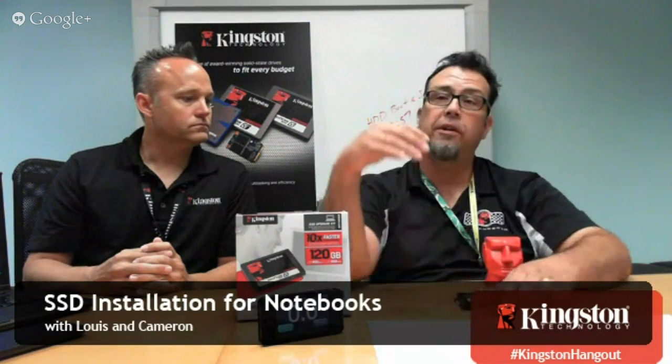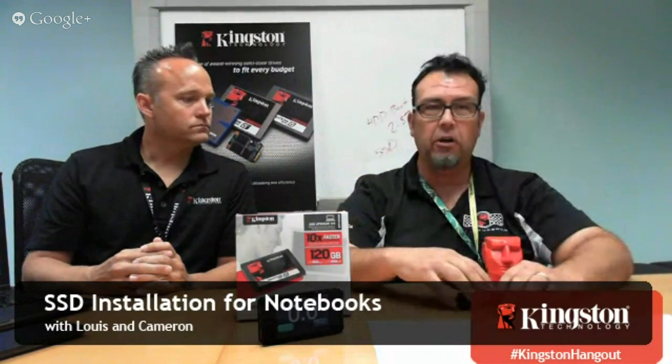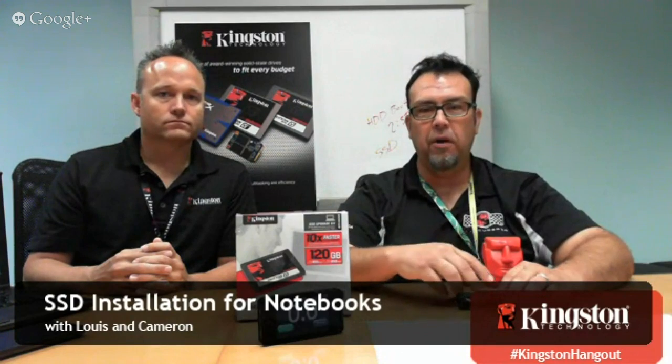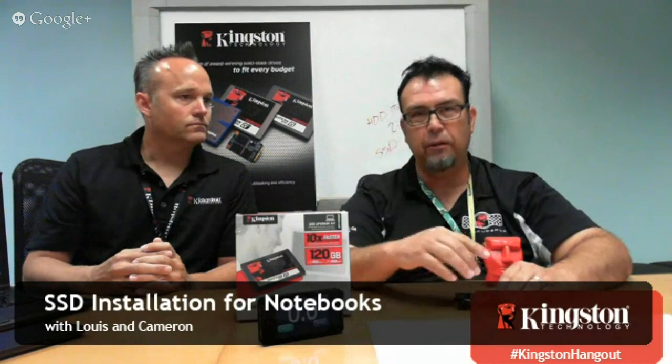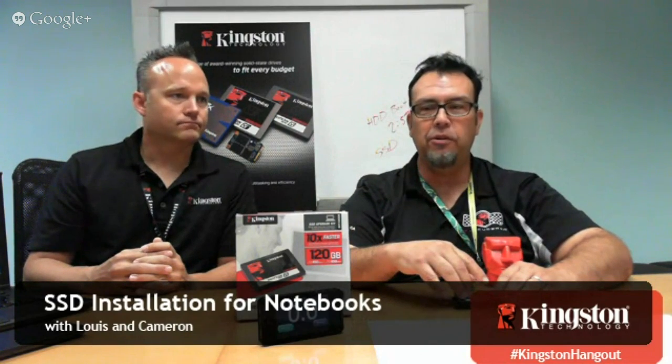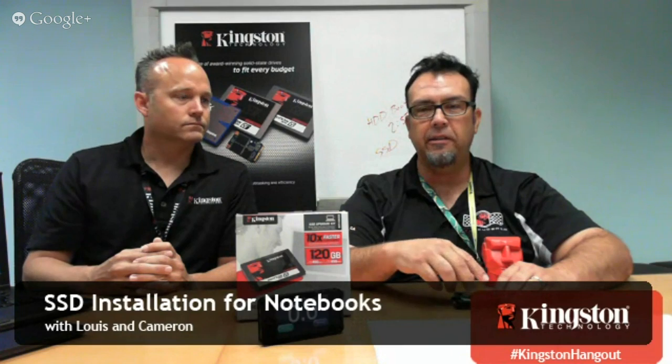It helps us wear the drive out more evenly. There's a feature on there called wear leveling that maybe some of you have heard about. What we want to do is wear the flash out evenly, and fragmentation is a part of that. So say no to defrag. Don't defrag. If you do, what you'll find is essentially you're just performing excessive writes on your SSD, which you really don't want to do.